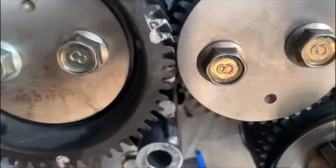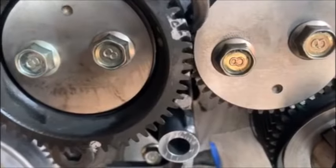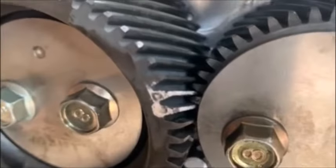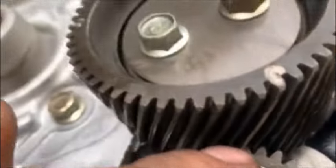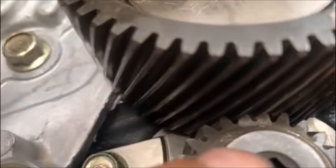Sorry to hold the camera in my hand, but that's the only way I can do it. There's the two markings there, and if you look down there there's a single marking on that gear, so that lines up. They actually made the whole gear white just to help you line it up, and the same with the bottom one. There's the single marking over there, they've made the whole gear white, and there's the two markings at the bottom in between. So you can actually not get the timing wrong.